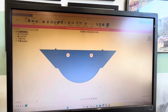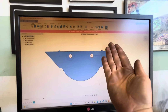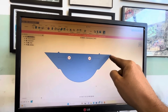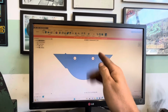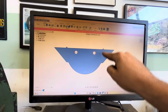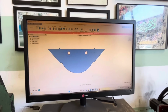So I added a 1/2 inch from the center point to the edge to compensate for that. These little wings on the side, they're gonna get folded 90 degrees. That is, from this point to here, is 1 3/4 inches, so that should come just about to the very top of our 2x2 tubing. Folded it over and provided a gusset. It's 1 3/4 inch to here as well, so that should be plenty strong. I'm gonna cut 2 of these out now, and we'll fold the ends up and weld them on.